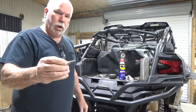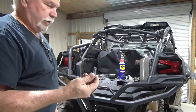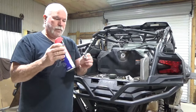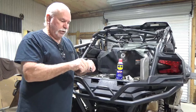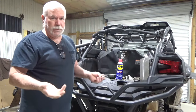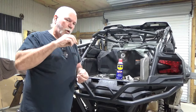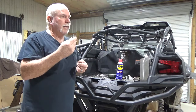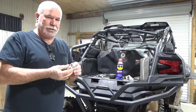You can see how black that is in there. These bolts are going to come out pretty hard, but put some WD-40 on it and run it in and out of that hole until you can do it with your fingers. If you use an impact, I don't recommend that. I know it's quicker, but pay attention — if you come all the way out and turn that impact to drive and you're cross-threaded, you're screwed.